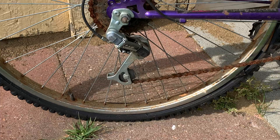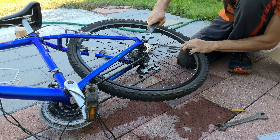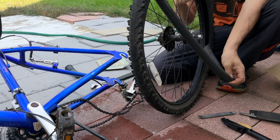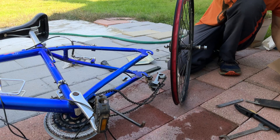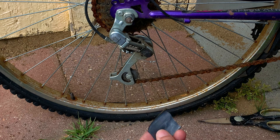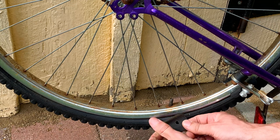The last event in my hundred-mile trial period was a flat tire — a very stereotypical bike thing to have happen, but I've never had a tire go instantly flat on me before. I sanded the rim for burrs, went with a slightly oversized tube in case the weight was an issue, and then used the old tube to make an extra layer of protection for the stem, because that's where I found a tear.